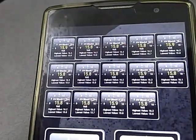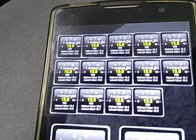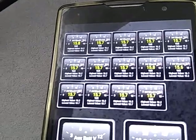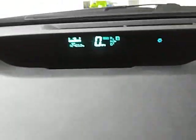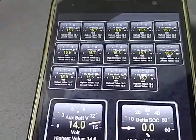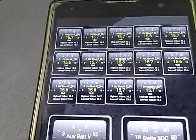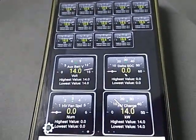This is a 2005 Prius with 124,000 miles on it. The cells are just about 16 volts, so they're down about one volt — but they're equal across all of them, which is probably about right for a Prius at this mileage. I think 17 volts would be perfect for a brand new battery. I like this tool for a Prius. The FIXD couldn't show all this stuff individually like this, and this was only $16.